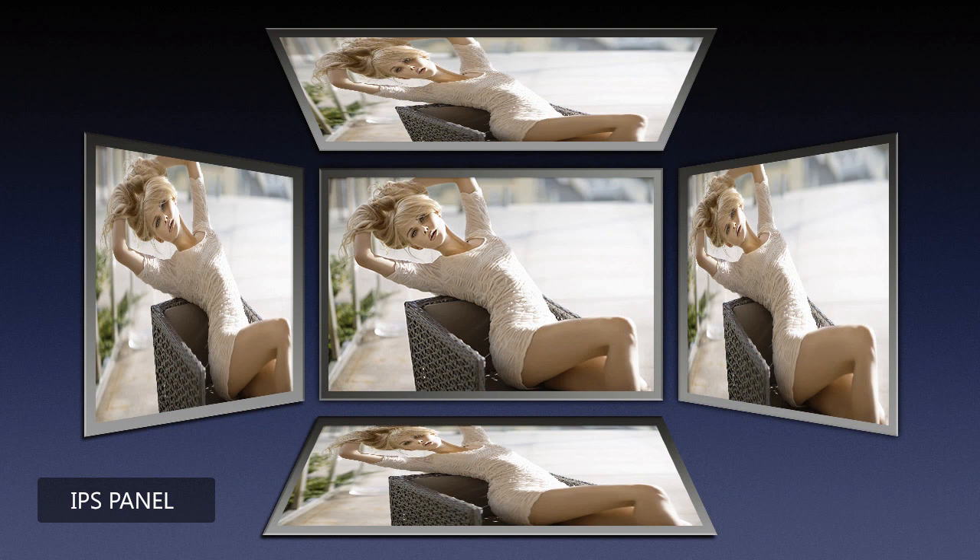Look for what's referred to as an IPS panel, which stands for in-plane switching. This type of panel has a very good viewing angle and produces quite accurate color. You can go from about 160 to maybe even 180 degrees and get very good color. This is useful because you can position a monitor so it's not completely 90 degrees to your eyes. You can shift your weight in the chair and your image won't shift as well. If you're working with a client next to you, they will also see an accurate image from a different angle.